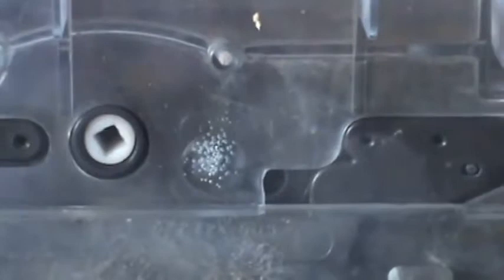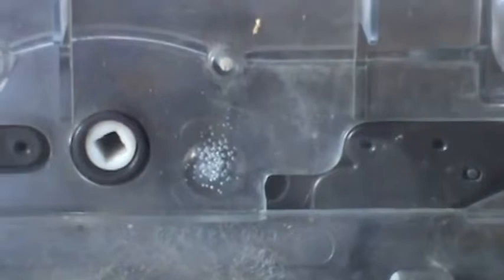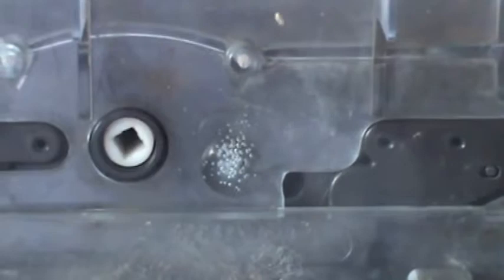In here is the turbine. You see that square hole — that's what turns to turn the brushes. For some reason that thing's not getting air, and it's not greased or lubed. With the machine on, the brushes are not turning.